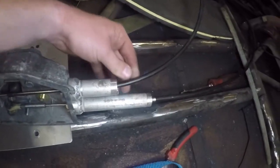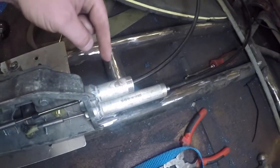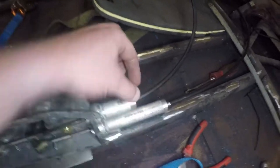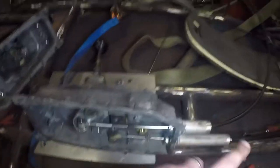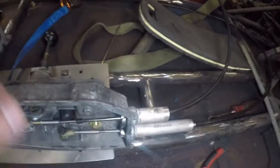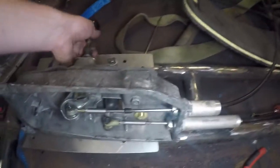There's a groove on these pieces and I've got to drill three holes through, tap them M3, and use M3 set screws as grub screws to hold that end of the cable — so I can take it out and replace it. I think it's about 35 quid each for a replacement cable; I just undo the set screws and take it out. The cables will be lifted up so the passenger's feet can go underneath them, and they'll both curve round and run underneath this bit of cage.